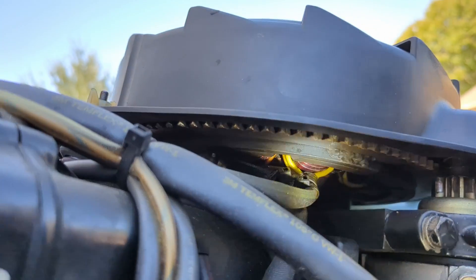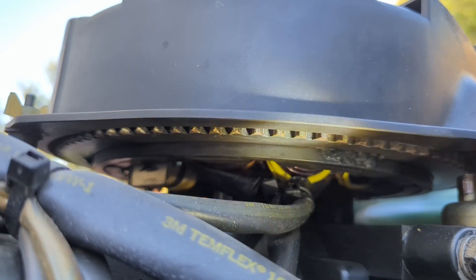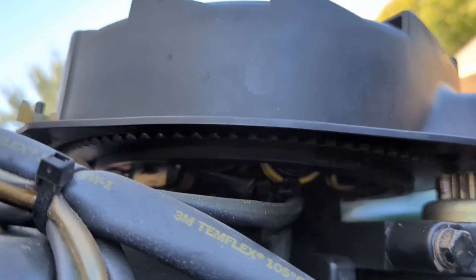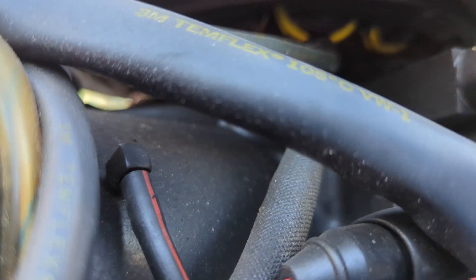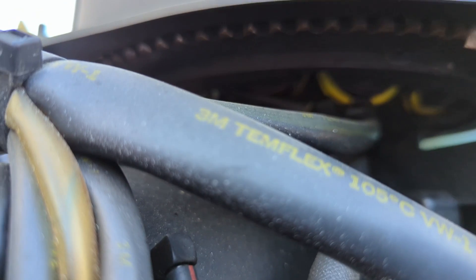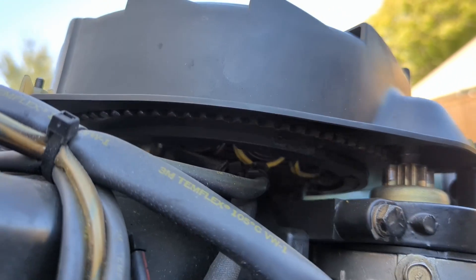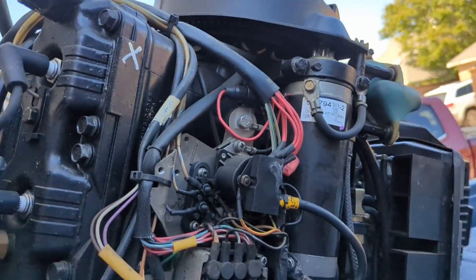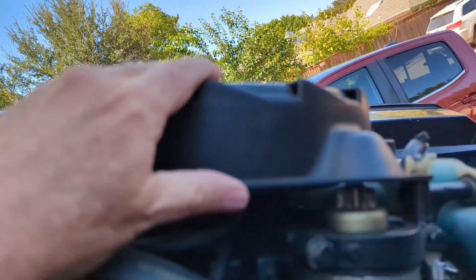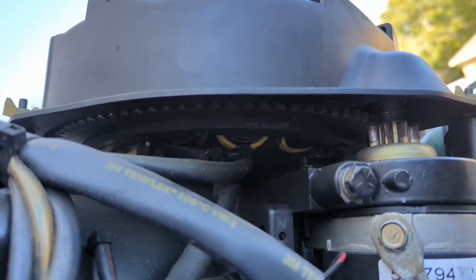So you can see the flywheel. What we do is put a screwdriver on that flywheel and just push it — that moves the drive shaft just enough. You keep moving it until you can push it up into the thing and re-bolt it. The other thing we could have done is removed the cover up here and turned the flywheel, but we were able to get at it from the side.